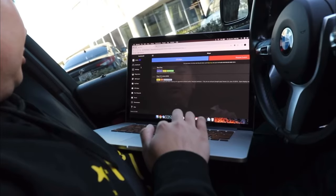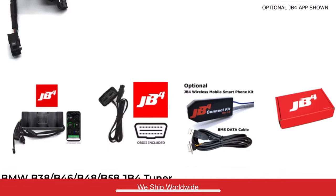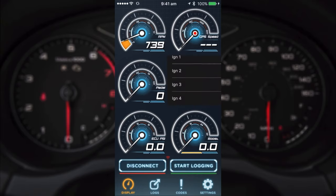Now we're on to number three — a tune. There are a lot of easy off-the-shelf tunes you can get, or you can get a custom tune. There are three main tunes people go with for the B58. The first one I recommend is probably the JB4 — it's probably the easiest one to do. They give you a little plastic module that you plug into your ECU and some other sensors on the car. You can also get a JB4 Bluetooth adapter to hook it up to your iPhone or Android device, check all your gauges — about 20 different gauges — and switch between maps. The JB4 is a piggyback tune; it doesn't flash your ECU, it just tricks the car. Some people think it's unsafe, but I think it's probably the safest tune you can go with.